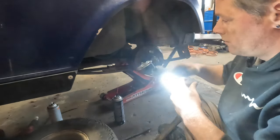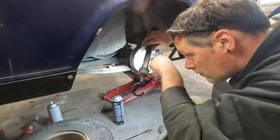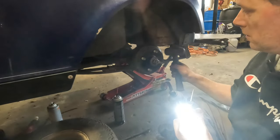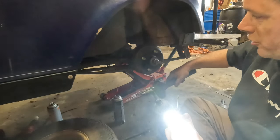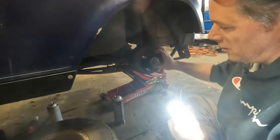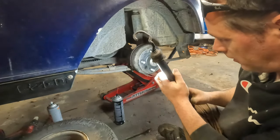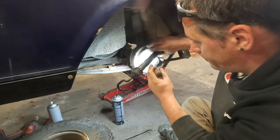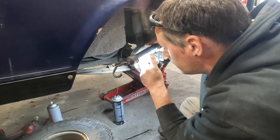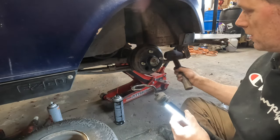Okay. So it's still not tight yet. Okay. So the drum's now getting tight. Now, you're not hitting this hard. You're just hitting it enough to help center the brake pads. Now, hear how it's dragging? And I can feel the resistance. So I'm going to pretty much go one more click here. Let's see it. Hold on. I got to get my head out of your way. Okay. Now it's tight. So that's where I'm going to leave this one.